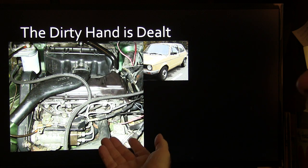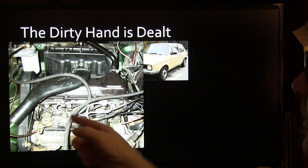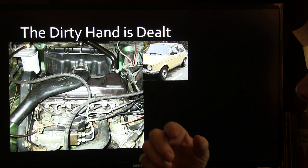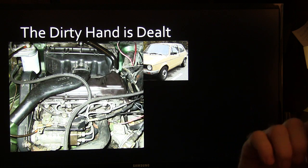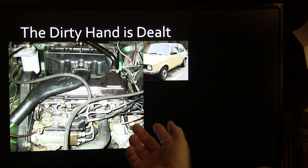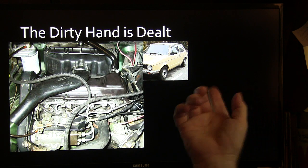They're supposed to have about 25 psi of fuel pressure down in this part of it. But when this thing's spinning over, it actually creates a vacuum that pulls the fuel out of the tank. That's the way that Bosch liked to do stuff. That down there was the vacuum pump like they use for the brake booster. Those diesels don't typically have vacuum. But anyway, that's actually a picture of a diesel Rabbit that I drove, or one like it.